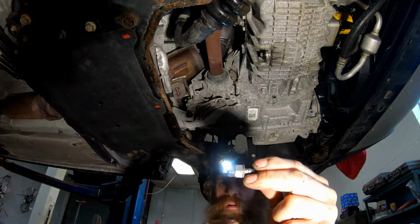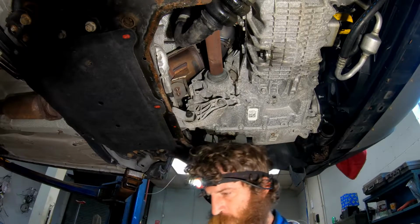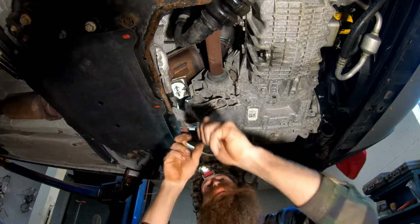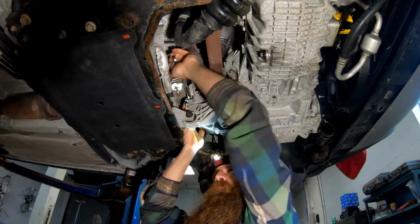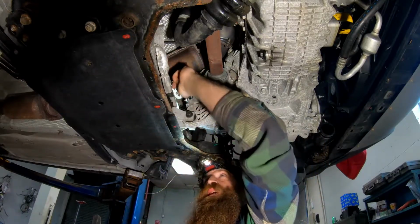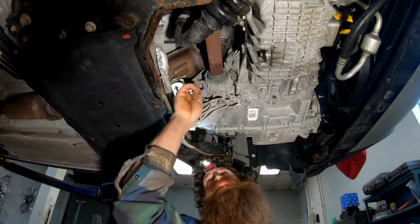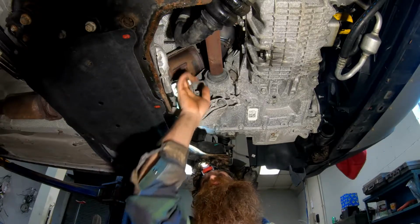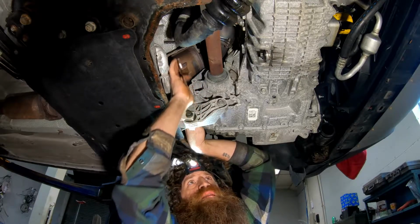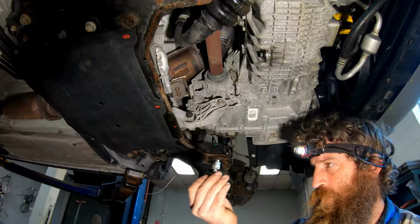Alright, just like that. Put a nut on the end, and it helps you get that whole stud out at the same time. Just get a regular old metric nut. As soon as you start twisting that 15 out on the stud, it grabs a hold of that nut and the whole stud will come out. Trust me, it's way easier that way. You ain't getting that bracket out with those studs in there. It's just not happening. So I remove the studs at the same time, and then I put bolts back in there. Alright, just like that. Got both of them out here. Just like that.